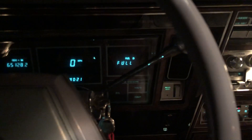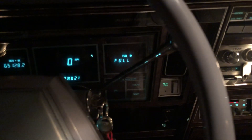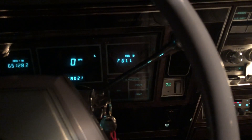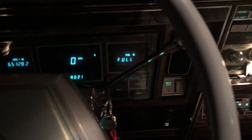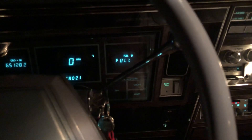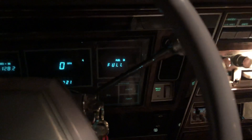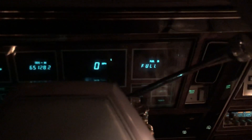I have an idling issue right now, but there's some interesting stuff: my fuel flow meter still works. That's actually where he did the small bypass — a small pinprick hole just a little bit past the fuel flow meter. As a result, it's giving just a little extra fuel than it originally did — just a hair, not much. Not enough to make it rich, but just enough so it's not running as lean anymore.